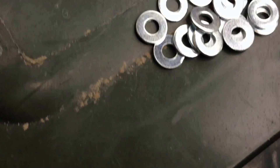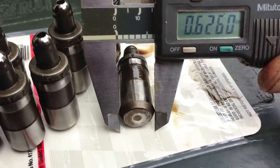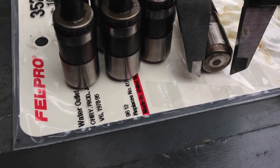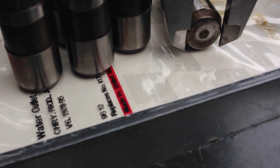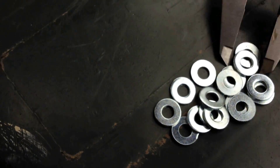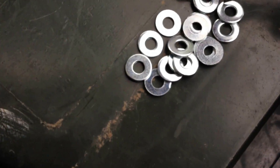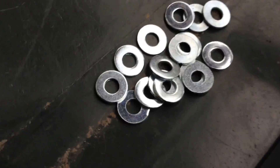I bought these basic washers. The diameter of these things is 0.626 on the outside, and the hole is 1 thousandth larger — so it's a 0.627 hole. It's a really tight fit. The base of these things down here is about 0.520, so you want it bigger than the base, but not 0.626 because then it doesn't fit down the hole worth a darn. The washers that I bought are 0.572 — right in between. Nice, good size.